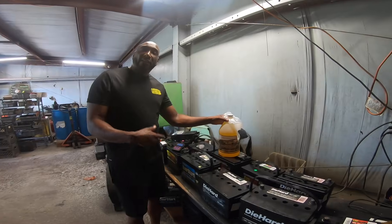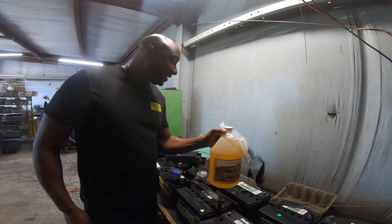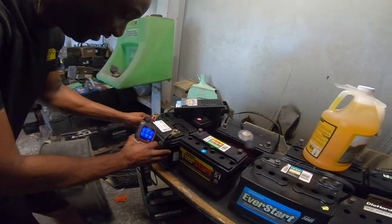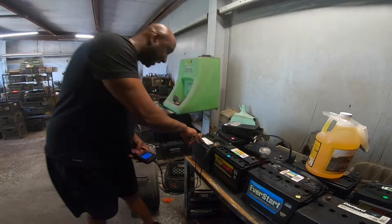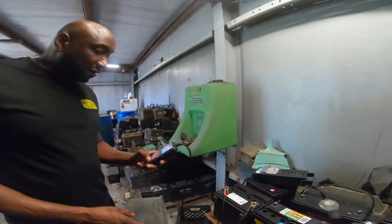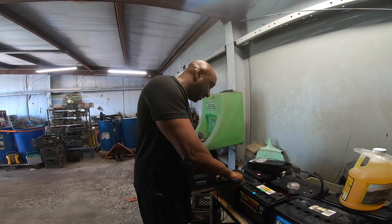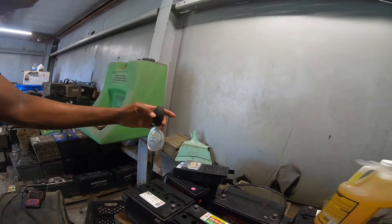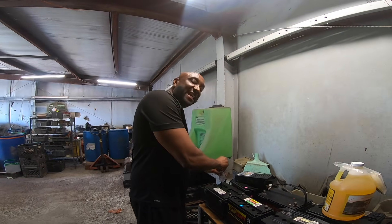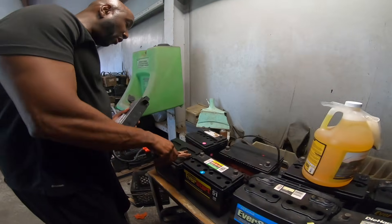If you have any questions or comments, leave them down below and we'll get back to you. We reconditioned these last night and here are the results using our high premium battery additive. Here's that first battery - January 2024, only about seven months old. Let's see how it came up. The original CCA on this one is 650. We're going to do a test on it - 688 cold cranking amps. The original manufacturer was 650, so we exceeded it. Now we'll do a hydrometer test to see the acid levels - just below 1300. That's our High 10X battery additive at work.